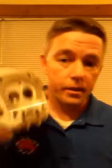Those are, to me, better engines to start with when you're going to build a modified, because you've got a bigger platform. You got more CCs, and on the Hemis and the Gen 3 non-Hemis, you've got a much better head. But if you're going to stay with the stock size valves, I tell people extensive porting. You got to go in there and really, really port it, not really make it bigger, but really port it good so that you can get good straight line flow and out of your seats, because that's the limiting factor. And when you're dealing with like stock appearing modifieds, whether it's the clone or the Predator, the valve size is very important.